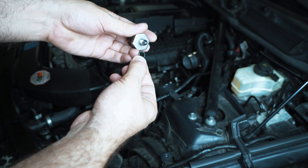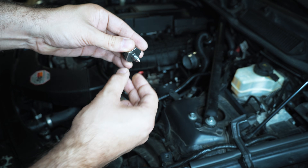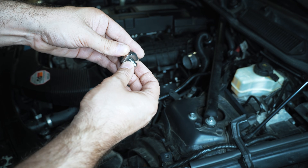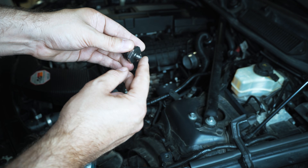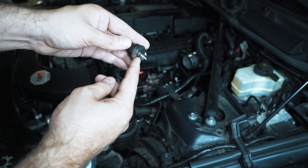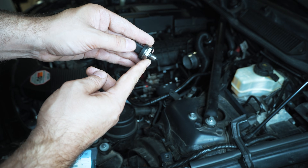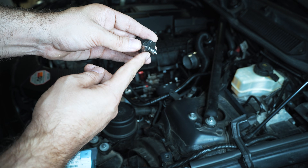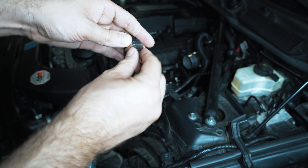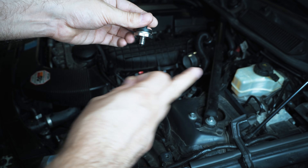This is how I've been running this sensor all this time on my original fuel line. I had an O-ring which would slot right in the back here and it was sealing, but eventually with time the pressure made its way past because of the way this sensor is designed and it started to leak. I could have just changed the O-ring and bought myself more time — this lasted 20,000 plus miles and two plus years of driving.